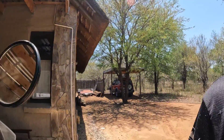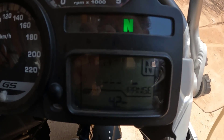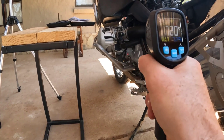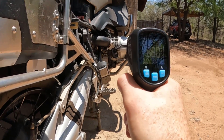Let's check the temperature now. I'm going to look at the oil temperature — you probably can't see the gauge but it's at 3 bars. Just before I shut it off, I'm going to take the infrared thermometer reading on the heads: left side 70 degrees Celsius, right side 68 degrees Celsius. We can compare that with the GS911 scan tool in a second.